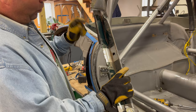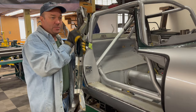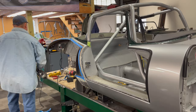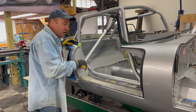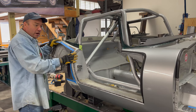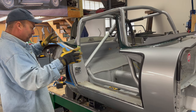It has just come right unzipped. These spot welds were not strong enough to hold it together — you didn't get a nugget. A nugget is when you test spot welds: you pull apart a test section, and you should end up with one piece of metal with a row of holes and the other piece with the metal stuck to it. That didn't happen here, meaning there wasn't proper penetration. Also, on older E-types, the seams — especially down in the shut face — are rusted and 60 years old. If you lock the car down and start yanking, you may move things but find later that seams have come apart.